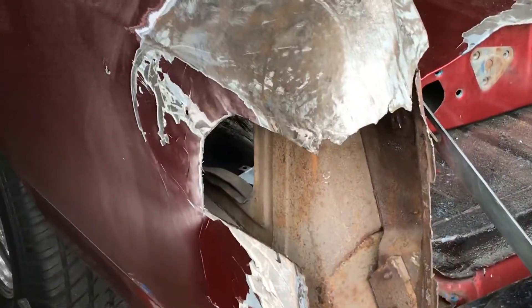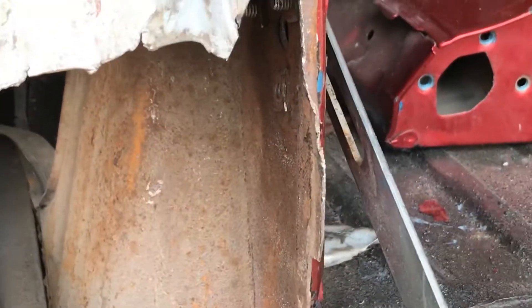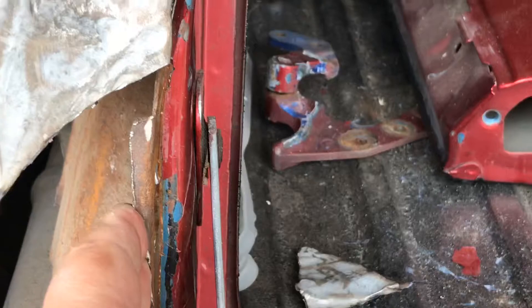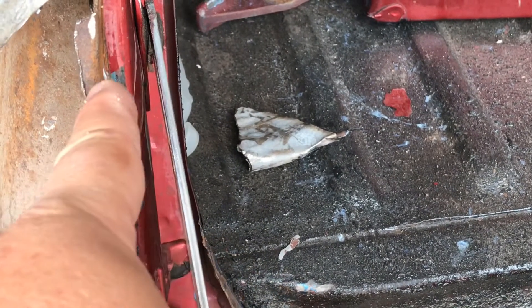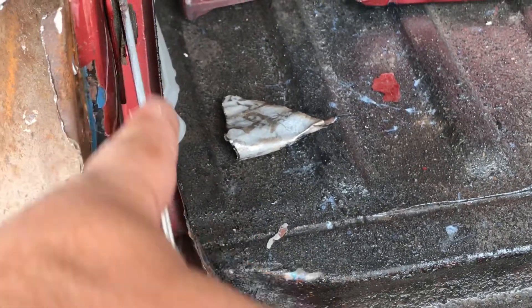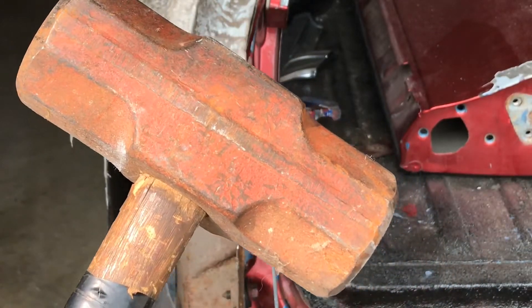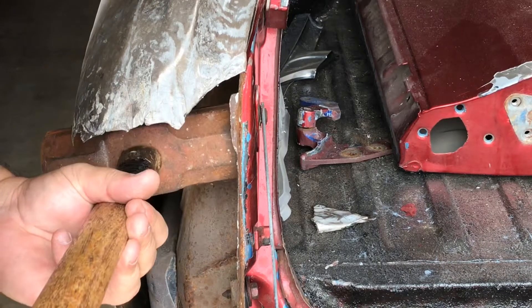The reason I cut that giant hole is we're going to replace this metal here, but also I need to be able to swing a sledgehammer through here to hit this panel and move it over. It's just a little too stuck yet. This line right here needs to come to about right there. Mighty sledgehammer — that'll get it done. Doesn't have to go far so I'm going to hit hard.